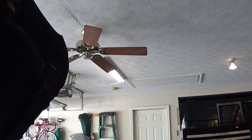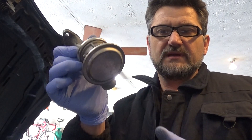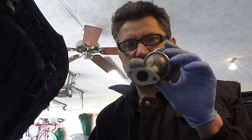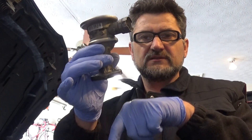So it seems like the check valve just opens by the pressure from the air pump. Let me get you down to a spot where the check valve is — I'll show you where it is. Here's the check valve. As you can see, there are no attachments to it. This is just the inlet where the air comes in, and this is the part that is attached to the exhaust — so basically the air comes from this direction into the exhaust.